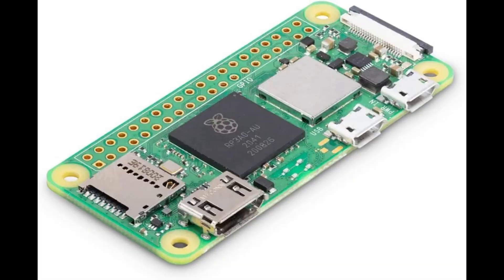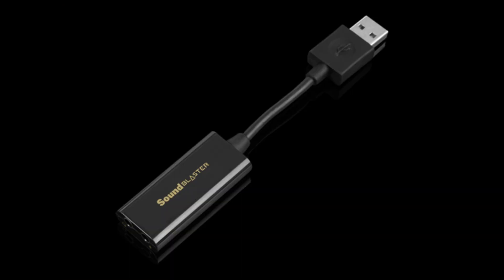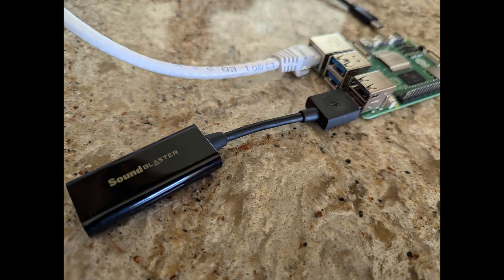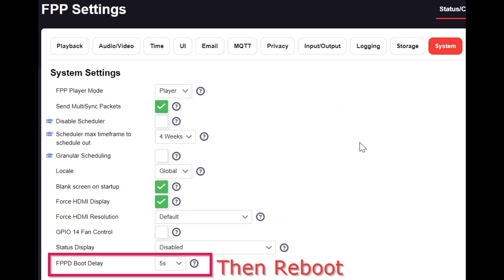If you're using a BeagleBone, Pi 5, Zero, or Hat, USB audio is your only choice — get the Sound Blaster Play 3. If not in stock, alternatives can be found in the description. Power off, plug in, turn on, select the Sound Blaster. Keep the volume at 70 and leave it. Add a 5-second boot delay if the sound card isn't showing up.